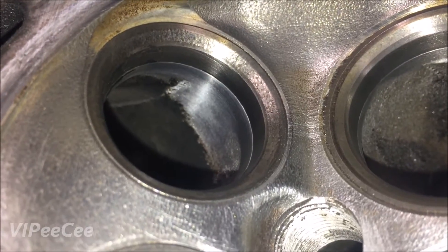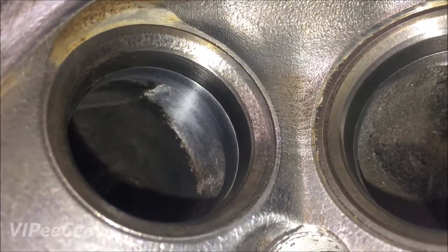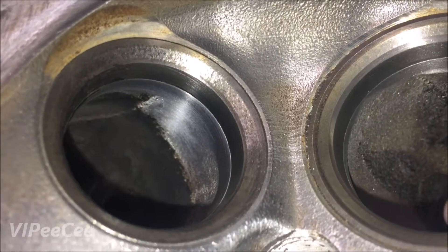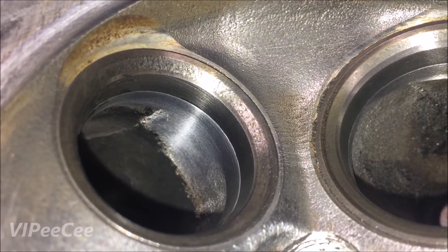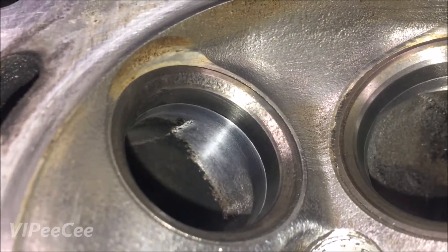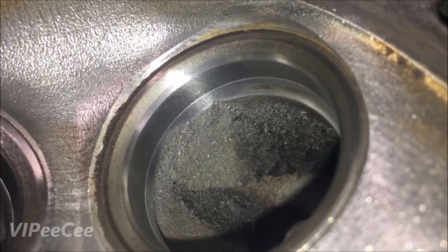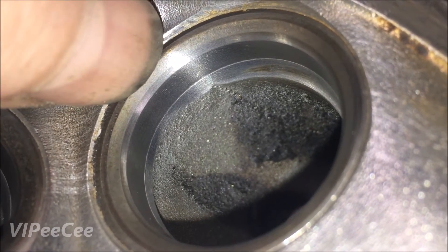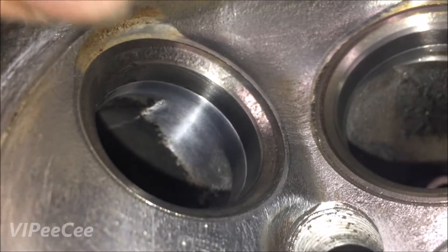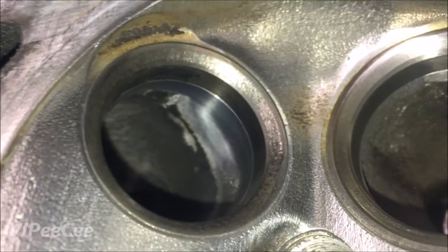You can pretty much see that the valve seat is not smooth. This one is in a little bit better stage of cleanup. I don't clean the entire ports out — I do make sure right underneath the valve is good; the more you can sneak past there, the better. Port and polish is completely different than actually rebuilding a head, but you can see that surface is just sad in comparison to how nice the leading edge looks versus how burnt down that exhaust side is.